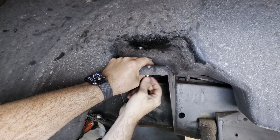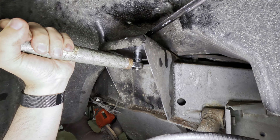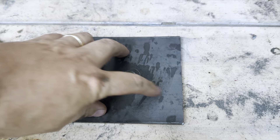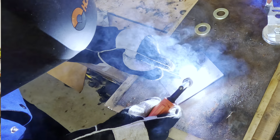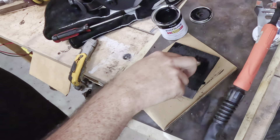I tried to get rid of the raised dome by crushing it down with my new plate, some washers, and a bolt. That didn't really do anything except bend my plate a little bit. Since I didn't want a gap between the plate and the top of the tower, I tried filling it with some thick washers. I tack welded them to the plate so they wouldn't shift around and covered everything with some black paint to keep the rust away.